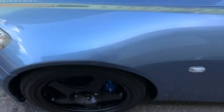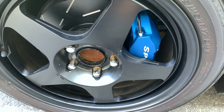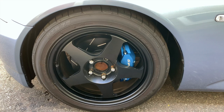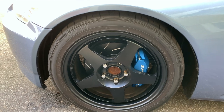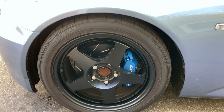So a little concern with clearance, because these spoon calipers do sit out a lot further than the original calipers did, but it looks like I've got maybe 7-8 millimeters of clearance. And I'll put the specs of my wheels in the description. I believe they're plus 38 in the front. I'll take a look at the back of the wheel because I got to do some stuff to it in a little bit anyways, so the front wheel has to come off. So I'll get that for you guys.